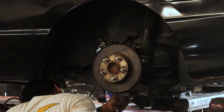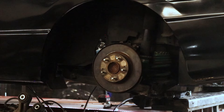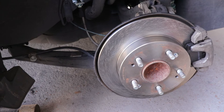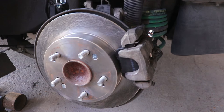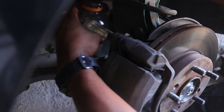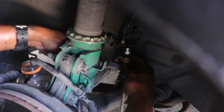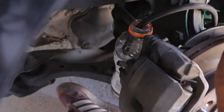Of course you want to bleed your brakes anytime you open up the system, so I took a ton of time sucking out air from these systems. Eventually it came out all good and the brakes feel great. It's the next morning and my drum brakes are gone and replaced with disc brakes — I have modern braking on my car finally. I also replaced the front rubber lines with stainless steel to match the rear. All products used in today's video will be linked in the description box below, including part numbers for everything you need.